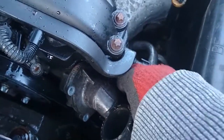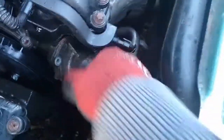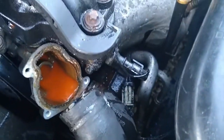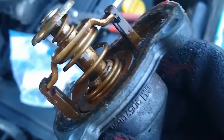As you see here, once they're loose the bolts will probably come out with your fingers. I'm trying to keep the radiator hose pointing upward here to avoid losing more coolant. Now would also be a good time to consider changing your coolant if it needs it. In this case it was changed only a year ago, so the red colour you see is actually the coolant, not rust.